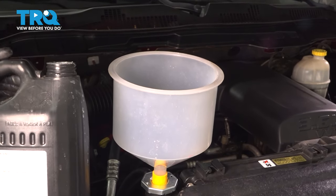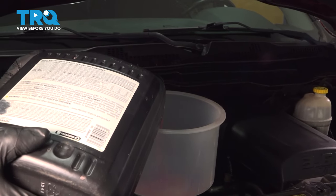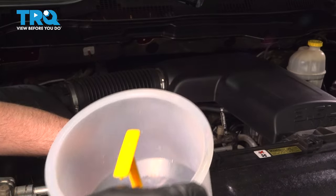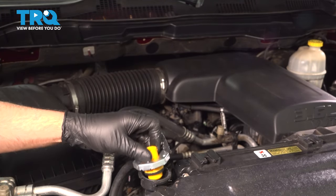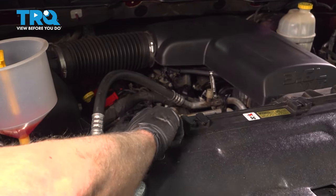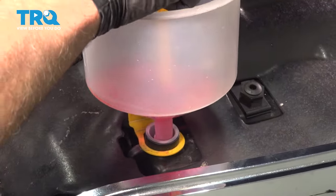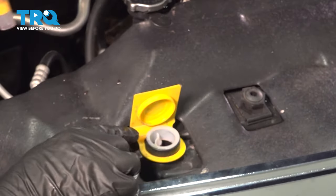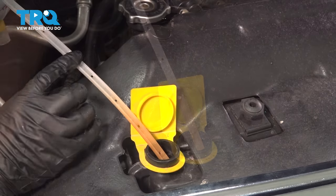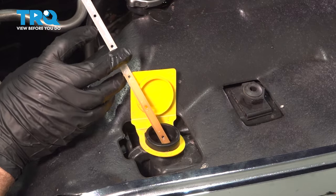You want to take the appropriate type coolant, a 50-50 mix, and just fill it up. That is full now. Take the funnel off and take the cap off. Put the cap back on — it's all the way full up here. Top off the reservoir. You can check the level on the reservoir with the dipstick. You can see where the max line is right there. You want to fill it up to that — you can go a little bit higher before you run the vehicle.